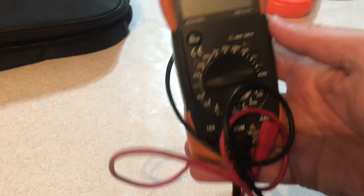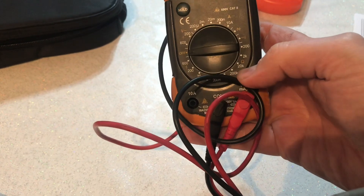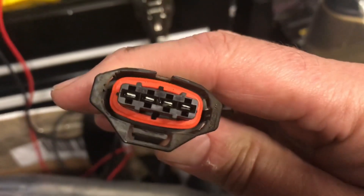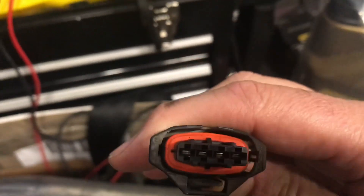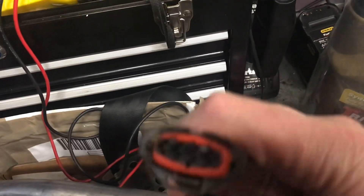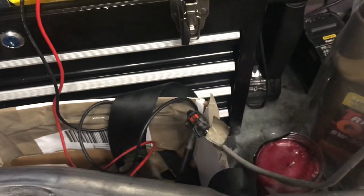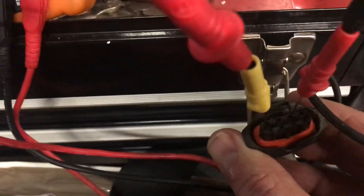What you need to do is find the resistance between that white wire and the other white wire. Get your DVOM and change it to the ohms setting to see what your resistance is going to be. You've got your four connectors and there are inspection holes provided as well — what you don't want to do is prise apart those connectors; you want to probe just above them into those inspection holes.